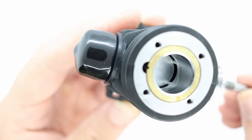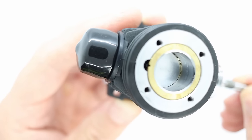Now, because the engine is so tight, there's a lot of friction between the parts. And that means that the temperature will be higher than on a fully broken in engine. Because of that, we run a rich mixture. Another reason for running a rich mixture during break-in is that we don't want all the oil and fuel to burn up. We want there to be some fuel left over in the engine so that the oil in the fuel can lubricate the parts.